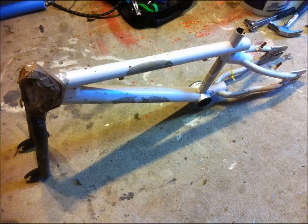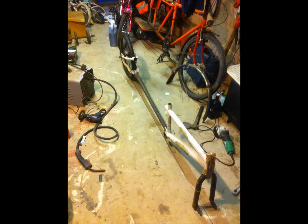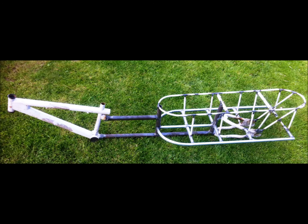What you need to do is start to think about cutting the rear chainstays, or a bit forward of that, and adding in a piece of metal tubing. This is sort of the structural backbone of the bike, so the tube needs to be quite thick. You just use a gasless MIG weld or something like this to weld that up — make sure the tubing is clean and then just get on with it.